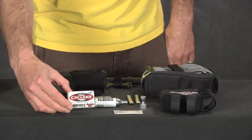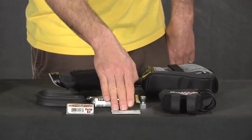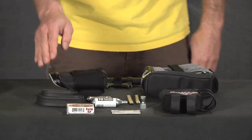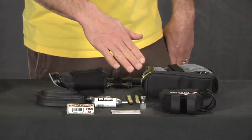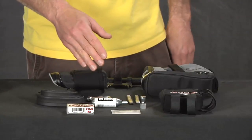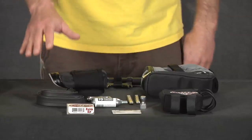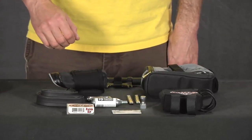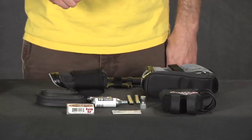You have a choice between a glue patch kit or a glueless patch kit. The glueless patch kit takes up a lot less room; the glue patch kit is a little bigger. With the glueless, all you do is scuff up the tube, peel off the patch, and stick it on. You have about a 50 to 75 percent chance of getting a permanent seal. Glue patch kits have a much greater success rate but take longer to affix. So if everyone's trying to hammer and get home quickly, you might just want to carry a glueless patch kit.